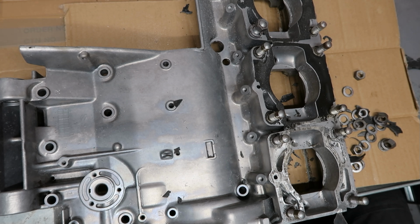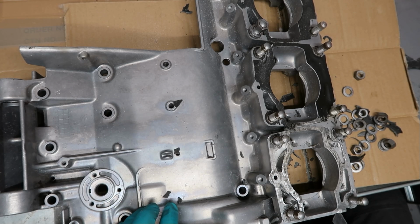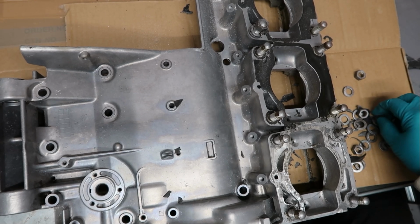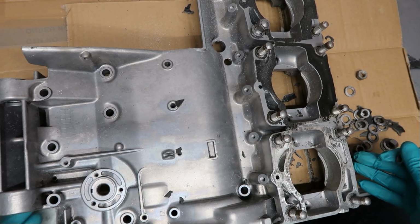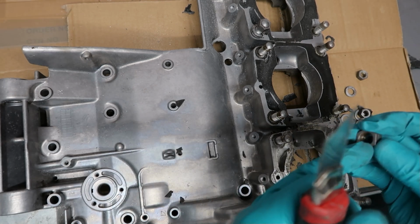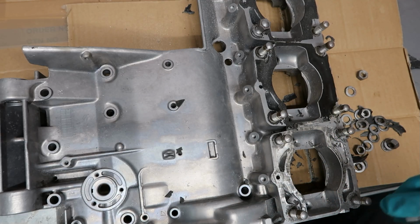One is, it shouldn't really be used for bolts which are required to remain in tension, okay, without a secondary securing device, right? And the reason for that is because the copper slip can allow the bolt to untighten, right? So the clamping pressure, because what you do, you tighten it down, so obviously you're creating a clamping pressure for the casing, right? But also it creates a friction on the surface here, and that locks the bolt.